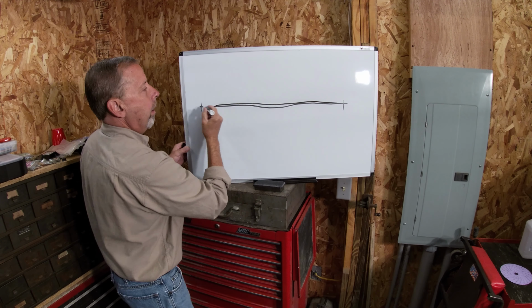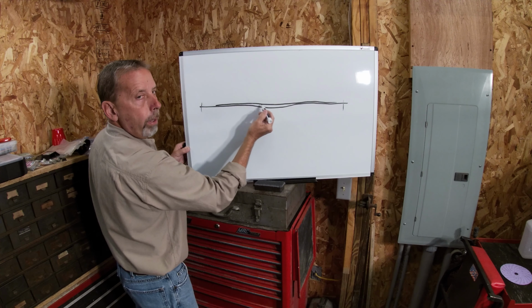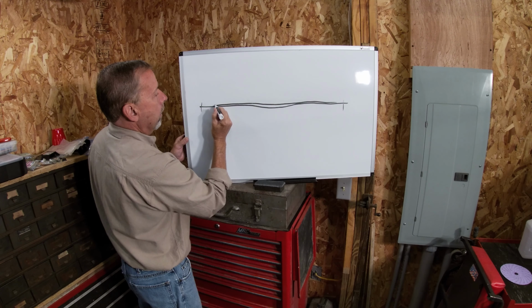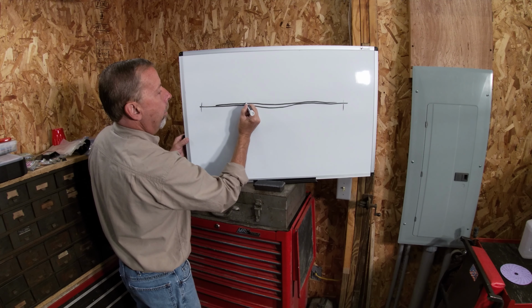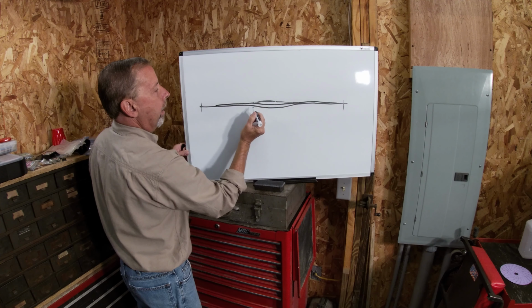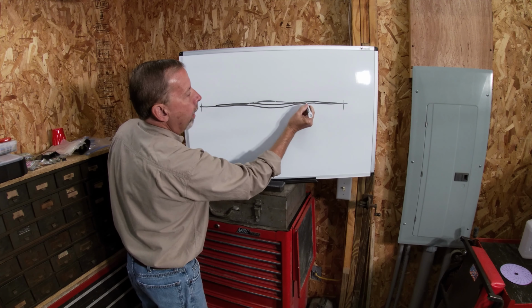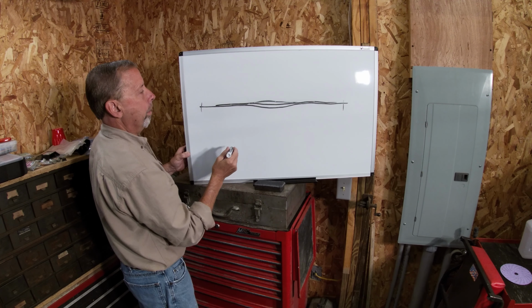So you're going to sand all this down, everything blocks out nice, but you still have that low spot, and you need another coat in there. So you have both sides pretty much where you want it, and you put another coat on here. Now you come back and you're concentrating on sanding this, but you're going to be cutting into your filler here, and cutting into your filler here. By the time you're done, it's going to feel like a washboard.